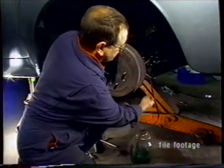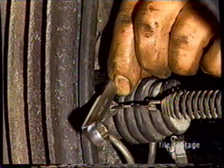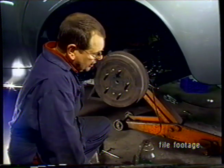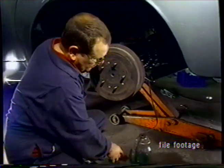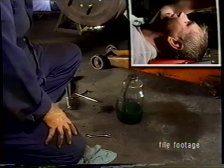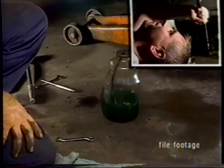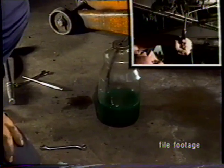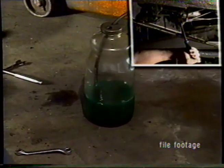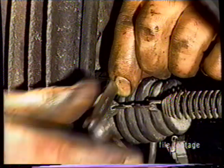Brakes: connect a rubber tube to the bleed nipple, undo the bleed nipple, and have your assistant pump the master cylinder lever forwards until you remove all the air from the system. Could you pump, please? When all the air stops coming, you can close off the nipple.